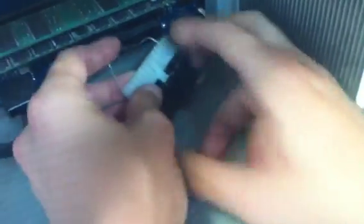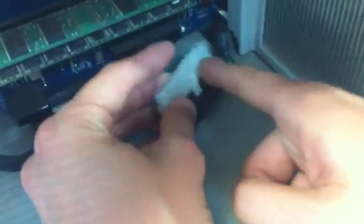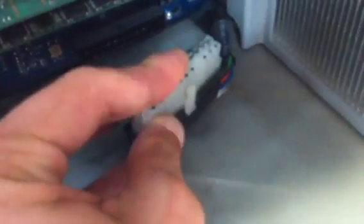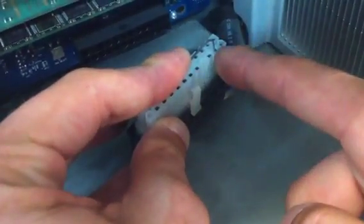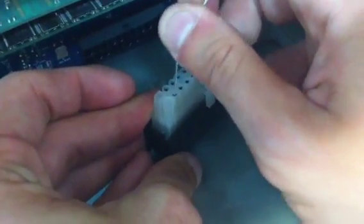What I'm going to do is jumper this green wire here that goes up to the second pin on the ATX connector towards the clip. This pin we're going to short to any other black wire. I always use the last one just because it gives me the most retention on the clip.